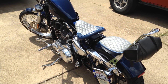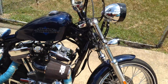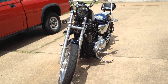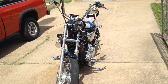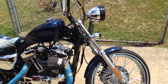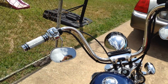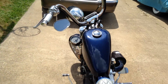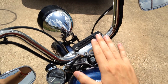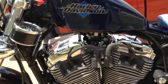If you didn't watch my other video, I'll do a full overview. The front stance of the bike sits like this — I did a headlight relocation and dropped my turn signals down. I did powder-coated trim rings to give it that chopper-style headlight and turn signal look. I did the three-inch risers, all chromed-out switches and hand grips, dropped my mirrors down, and did a speedometer relocation off to the left side of the tank. I got rid of the whole assembly up top and did the chrome bar clamp and indicator light bracket.